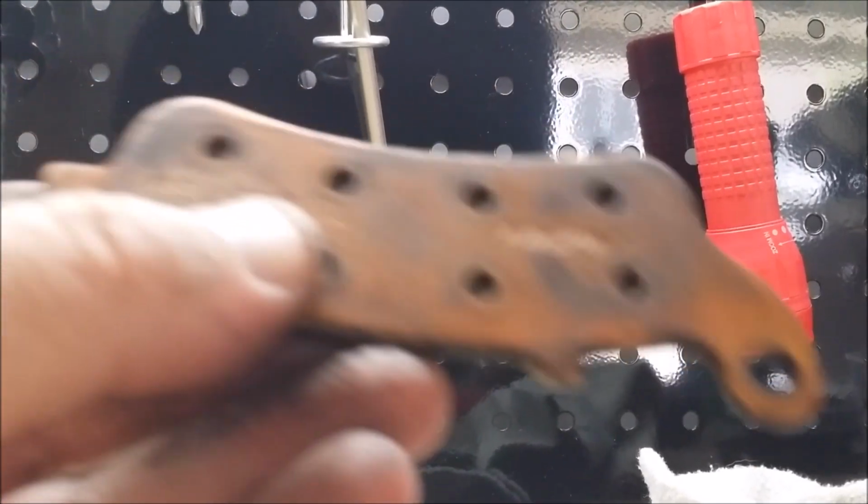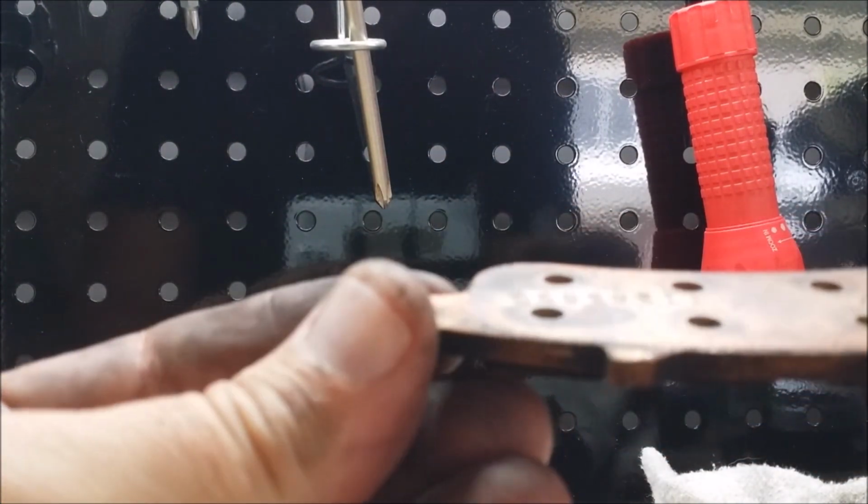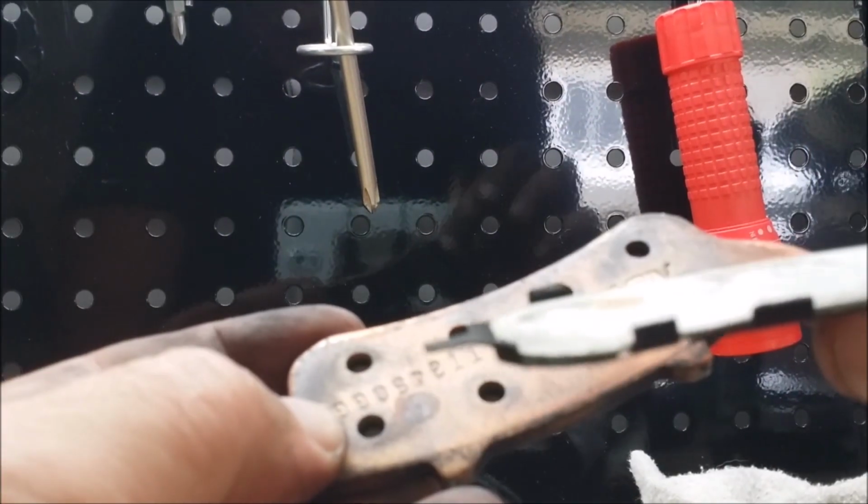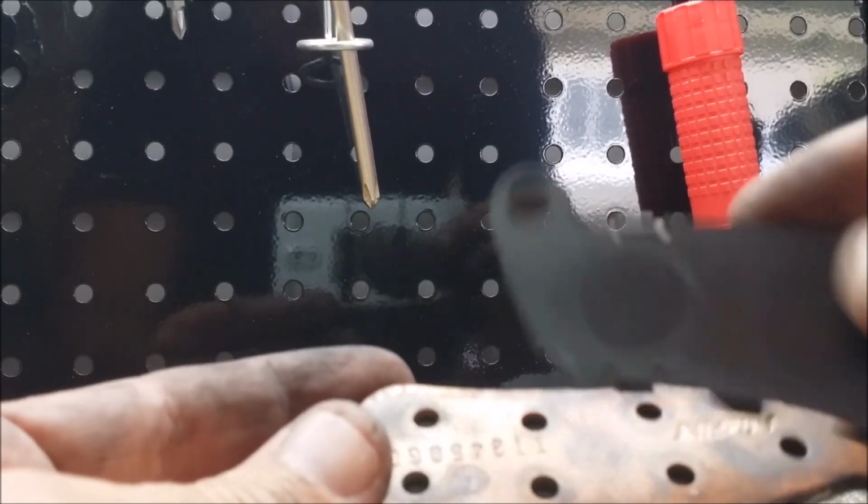Okay, so yeah, on a normal bike, because I've changed pads on my Vulcan 900, it didn't have these plates, okay? These are like Honda deals or whatever, but you don't see these on other bikes. You can tell this is the one that went up against the caliper there. So I pulled that off, and I've cleaned that up quite a bit. But normally, you won't have this back thing on there. It just seats on. So I'm not sure if the squeak on this would be coming from between here and here, or actually as it's seated on the bike, if the squeal would be coming from grease on the back.